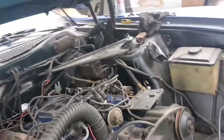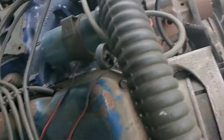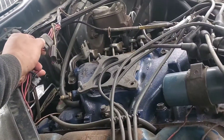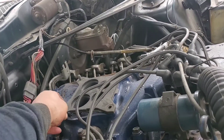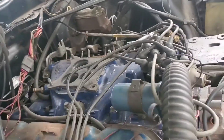Over here I had to remove the wiring harness. I could disconnect it from right here, so I'll disconnect it from right here and leave the ignition coil on there. I'll bolt up the engine mount plate so we can lift it up and then go from there. Should be smooth sailing now, I think, if nothing else is in the way.